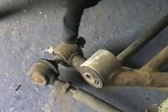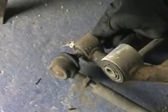The other side connects to the chassis here, in this aperture, and the bolt goes through. The bolt that connects it at the bottom is actually the stud for the track rod end — sometimes called a tie rod. Here it is. This is the lower wishbone arm, and this is the track rod where you can adjust the tracking at the back of the car. The track rod end goes through the chassis mount, through the bushing on the lower wishbone arm, and then you tighten it up at the bottom. That came out without much difficulty.